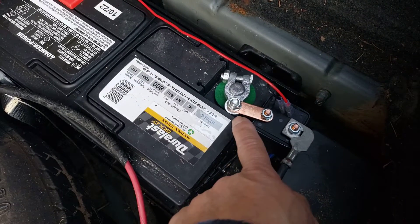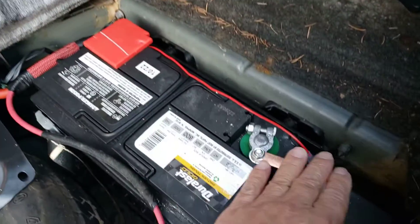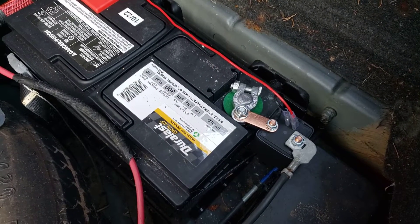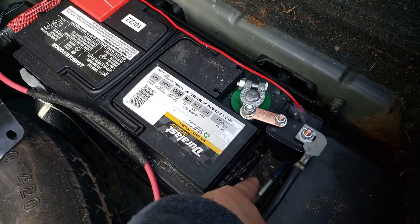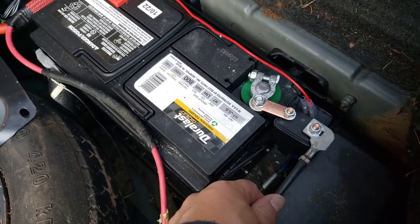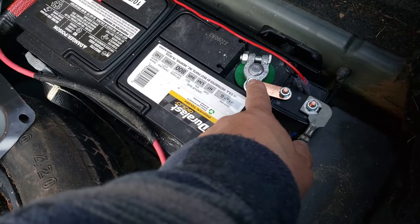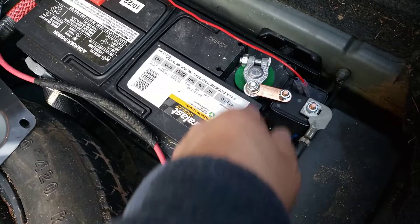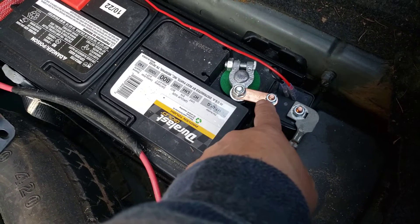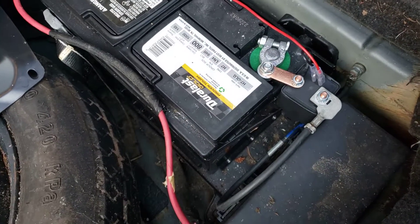This is just temporary, because for this to be modified, the cover is not gonna go over it — it's gonna hit this piece here, so we'll have to modify it and come down with a separate cable mounted totally different. The negative cable goes to one side of the relay, the other side of the relay goes to the terminal on the battery. The little black wire grounds the relay right here, and the positive goes over here.